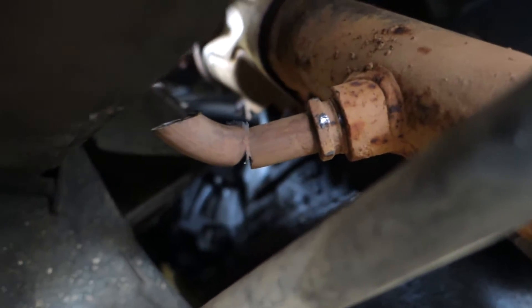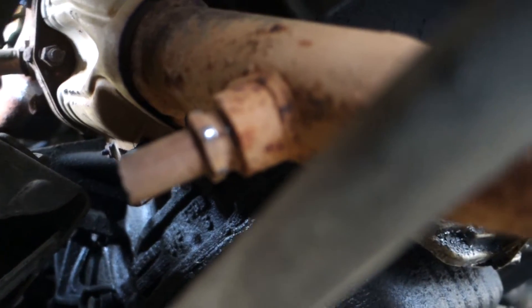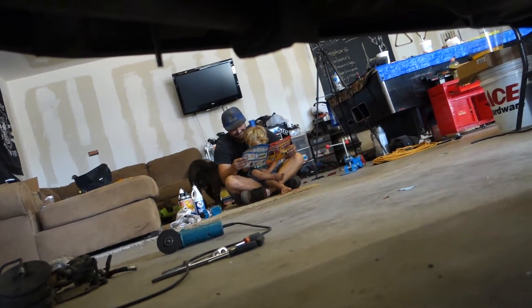There was no way that nut was coming off. I ended up cutting off this tube and cutting this last little section off right here. Still a little warm. What we're going to do is get up in here and crimp this — just pinch it, fold it over, or weld it — pinch it together and weld it, just so we don't have exhaust pouring out of there. Look at Ronnie and Levi over there doing Christmas family stuff, looking at the Summit Racing Christmas catalog.